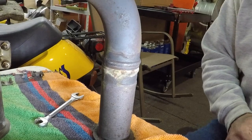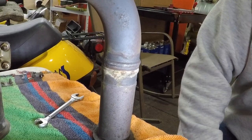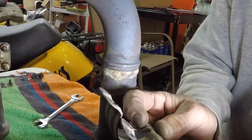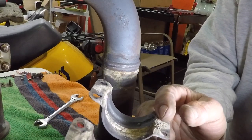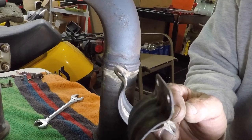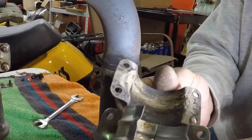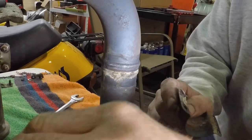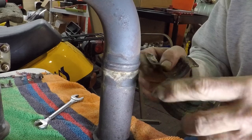Good morning ladies and gentlemen, welcome to Grumman Pilots YouTube channel, directly supporting the Grumman Pilots Association. We're going to be looking at bead clamps this morning — these are bead clamps off of a Cessna or a Piper. You'll notice that they don't have the inner shield that we need on our airplane. So we're going to be installing these, and we're going to be using the Walker Acoustical Seal.